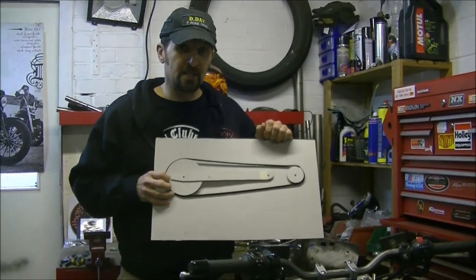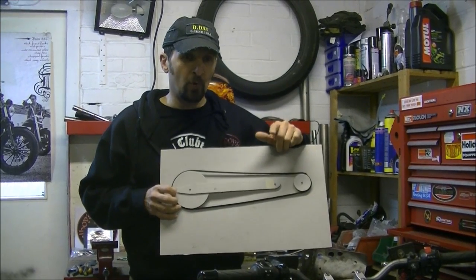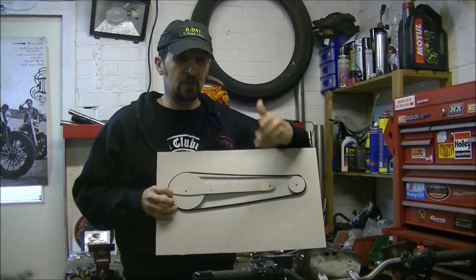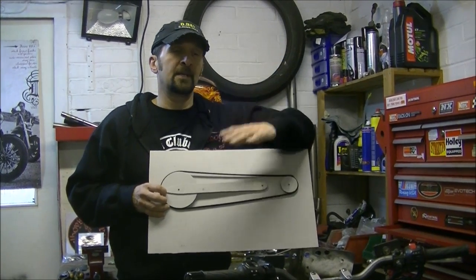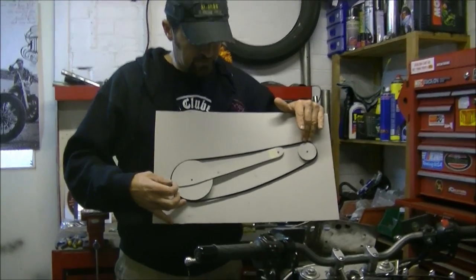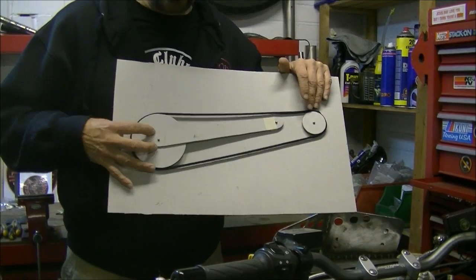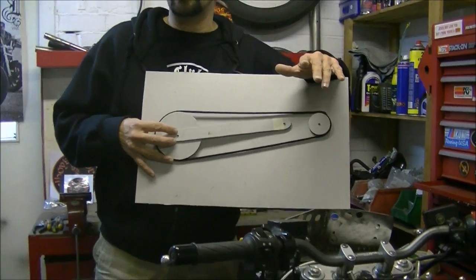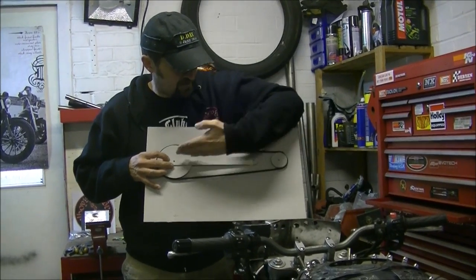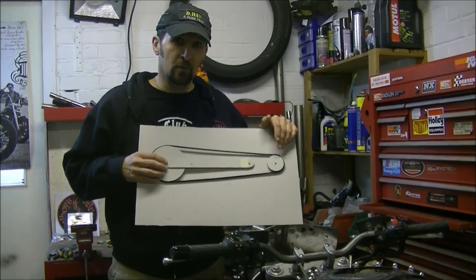That's why you must have that little bit of slack — it's absolutely vital. If you have a Harley Davidson with a rubber belt, it's even more important that the belt is tensioned correctly than with a chain and sprockets. If you're going to jack your Harley Davidson up to make some sort of custom bike like a flat track racer, you're going to create unnecessary and unacceptable slack in the belt, so it's important to fit chain and sprockets if you're going to raise the swing arm. Most cruiser bikes are very low and their three axles sit in a row, which makes them very straightforward.